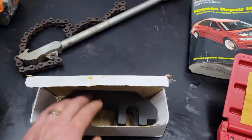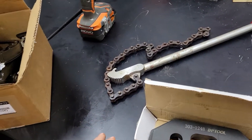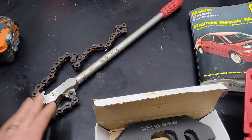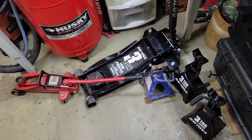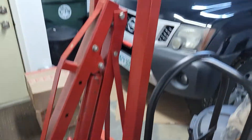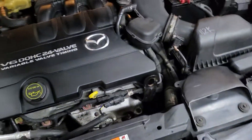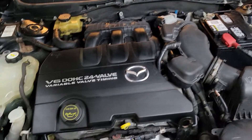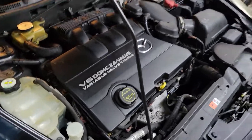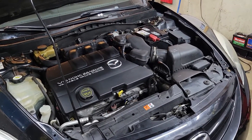You really should get these tools. I think you could take the starter off and jam something in the flywheel — there's a different trick for holding the crankshaft — so maybe you don't need the locking tool. But you're definitely going to need jack stands, a couple jacks, and probably the biggest deal killer for a lot of people is you're going to need a hoist. You're just not going to lower that engine and move it over without a hoist — you shouldn't try. Other than that, I'm going to go get an alignment because I had the subframe off and that might have shifted things around a little bit, and then this job will be done. Thanks for watching, and if you try to tackle this, good luck!